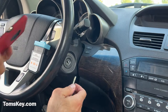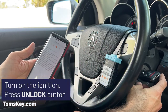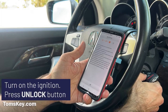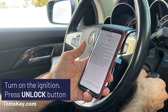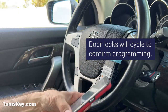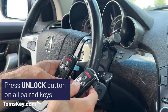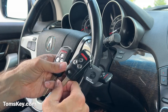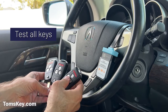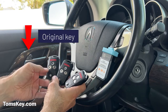Open the car door, shut the door — we're kind of starting over at the top here. Take the key, insert it, turn it on, press the unlock button, turn it off. Turn it on, unlock, off — repeat this cycle. We just heard the lock cycle. Do this one — heard it cycle. Not touching the original one. Turn it off. Let's check all these: number one, works. Number two, works. The original one, works. Excellent.